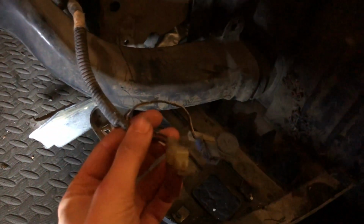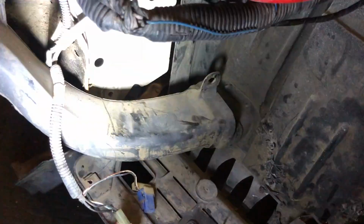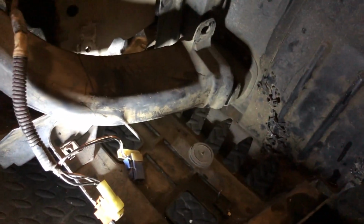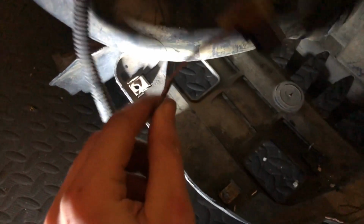All right, so other than the pipes that I need to do, moving the windscreen washer bottle was pretty much the last job I needed to do. So this is obviously where it's sat. This plug is the one that goes to the main windscreen washers. The blue one goes to the rear, but I've already blanked that off. So all I'm gonna do is cut them 3 wires and extend them.